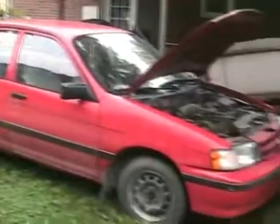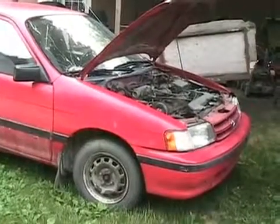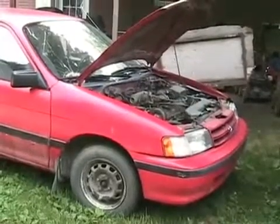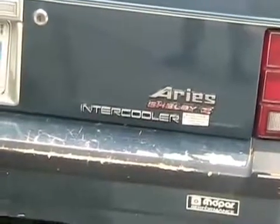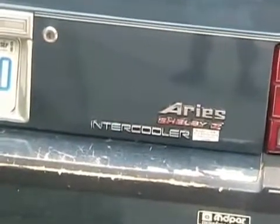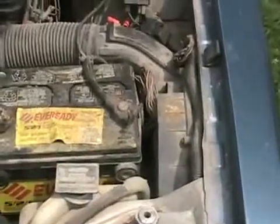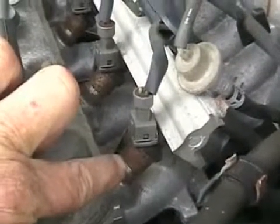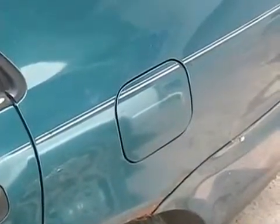So if you are planning to add a forced air induction system of any sort to your engine, you have to be aware of a MAP sensor that reads pressures up to, say, 15 psi, like I run my car on. You see, forced air induction MAP sensors have a different range of pressures that they can read. Some only go up to 10 psi, some 7 psi, some 30 psi. You never know. Then you have to have the appropriate computer that can read those different readings it's sending it. And higher flow rate fuel injectors. And maybe in the gas tank even a higher volume, higher pressure fuel pump.